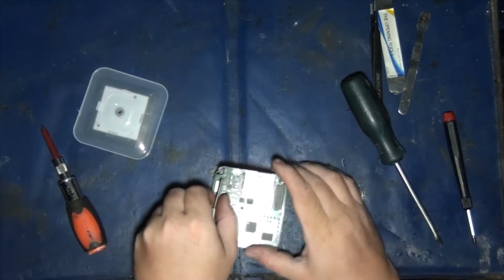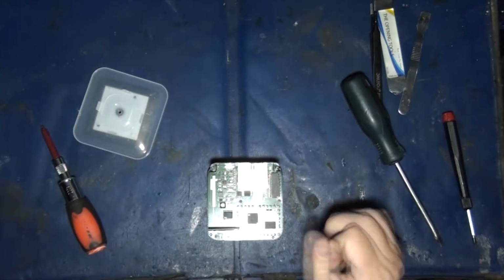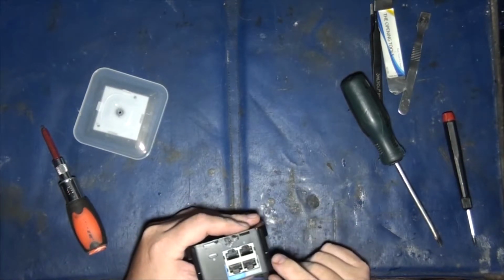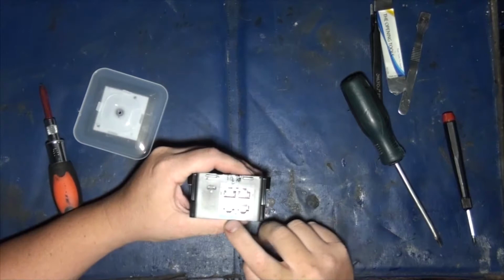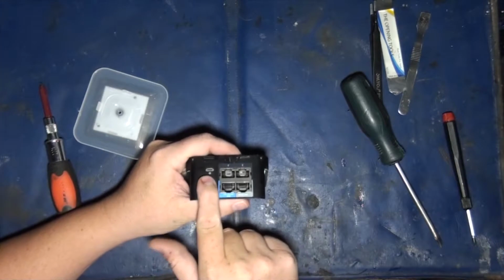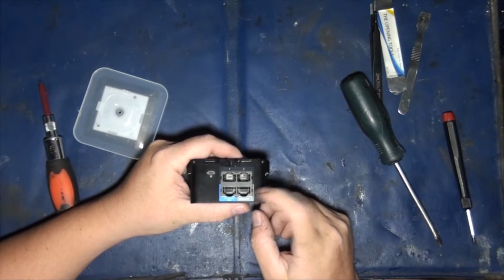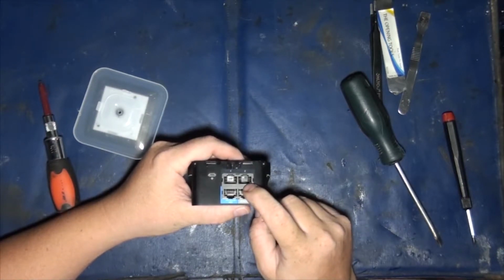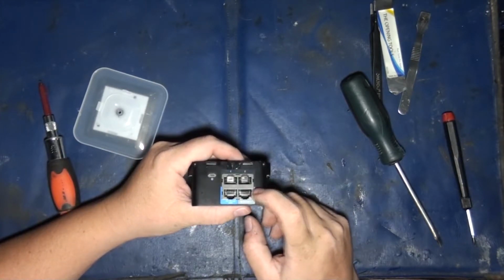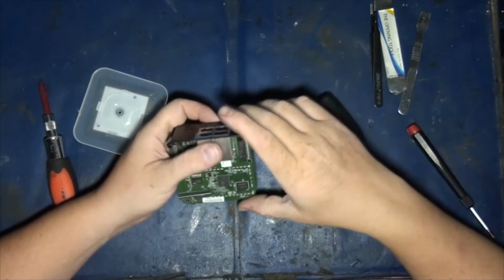All right. Here is what we're looking at. First of all, there's your whole circuit board. Reset button's on the bottom. These are great because they've got four ports. You've got your 24-volt PoE in, you've got your 24-volt PoE out, which is your WAN. The recommendation for you guys, what we've been doing, is we aren't using those ports. That will not power a radio properly. We're using a 1-amp 24-volt PoE in on here, and then we're taking the LAN port of that PoE and connecting it to a power line kit, so we can stick little power line extenders throughout the house. This one's going out to the CPE. And then these two ports there are just for whatever the customer wants.